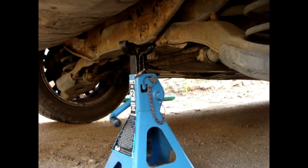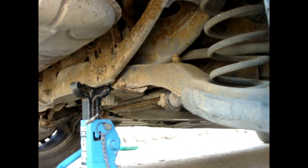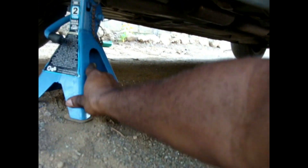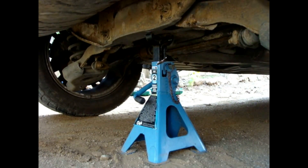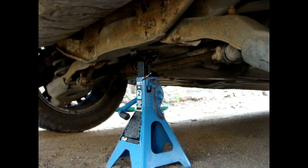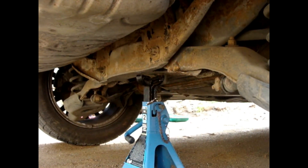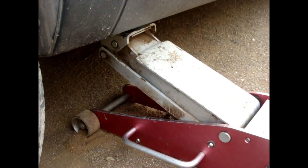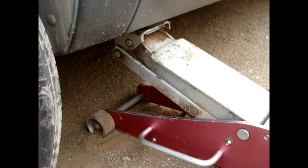When placing the jack stand, look for some part on the chassis. I've chosen the suspension and installed the jack stand. When installing the jack stand, do not go underneath the car — this is for your own safety. By the way, the insurance doesn't cover stupidity, so work safely. After installing the jack stand, lower the car onto the jack stand and just leave the jack as is as another safety precaution.